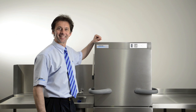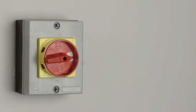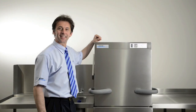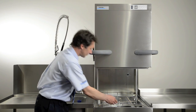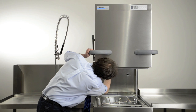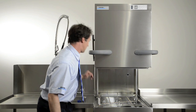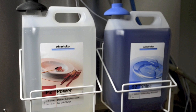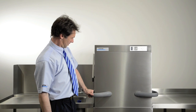Let's look at switching the machine on and starting up. Switch the machine on at the wall isolator — it will look like one of these. Next, ensure all the items are in the correct position, especially the wash filters. Now check the upper and lower wash arms are in the correct place. Now check the detergent and rinse aid containers are full and primed. Do not load any items into the machine at this stage, and please close the door.